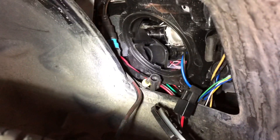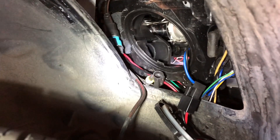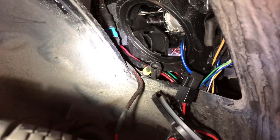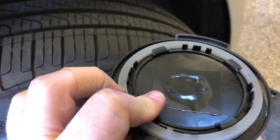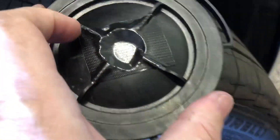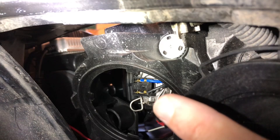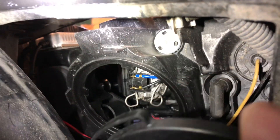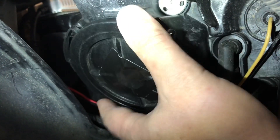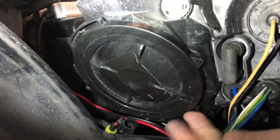You're looking at probably $60 to $80 for new ballasts, so this reinforces my idea to just stay with the H7 halogen bulbs. I'll bench test these ballasts in a couple minutes. The hole is sealed with two layers of Gorilla tape — that's gonna be good for now. I'm probably just going to leave these and not mess with HID anymore. The H7 plug has a little notch that goes on the bottom — make sure you don't get it in upside down. The little bracket just slides in with a slight turn.